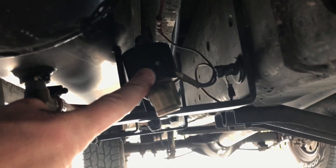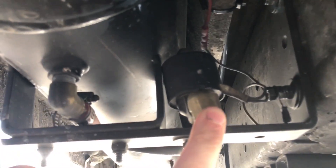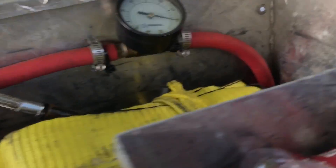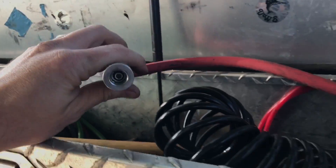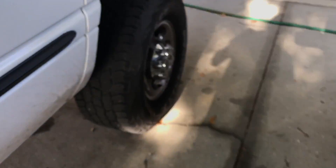This line comes from the compressor into the cab and feeds the in-cab gauge, and it also feeds the airbags — teed off in there. There's an electronic solenoid controlled by a switch in the cab, connected to the bottom of the tank, with a 90-degree fitting so it doesn't fill up with dirt — that's how I purge it. If I'm running it a lot I can dump the water and oil from inside the cab. It comes out of the back of the tank and runs up to the bed where there's a gauge, which is where you do most of your work.